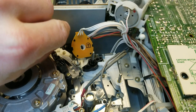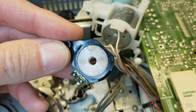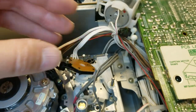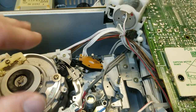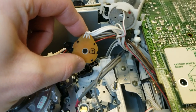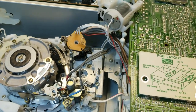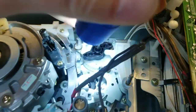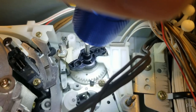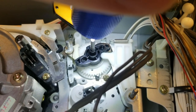He says there's a marking on here — see that little arrow — you put the little peg towards the arrow, and that's the unloaded ejected position. But when I go to slide this thing into place, it won't slide. The reason is there's a second key — see that little white piece in the middle of the hole there — that lines up with this black piece. And if you see, that's 180 degrees out. So this gear that the rotary encoder switch attaches to is 180 degrees out.